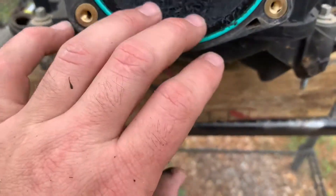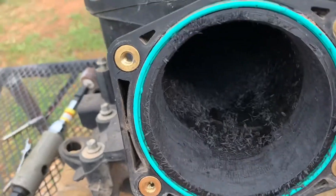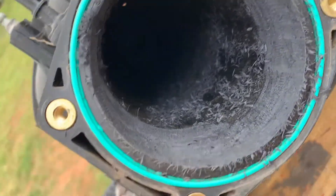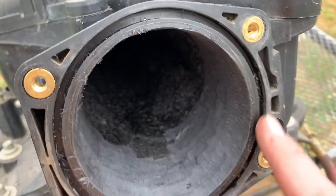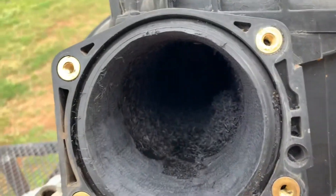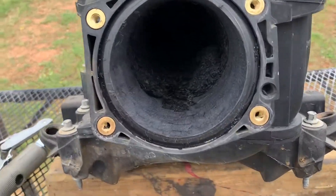All right, so we got to start getting close down here. I'll port it pretty good, get the mouth open, then I'll blend it all the way back and try to get these high spots out of it. I pulled the o-ring out - it's easy, just pops out with your fingers. As you can see right here there's a little bit of a lip, a little high spot. We got it pretty well blended on the mouth where it kind of tapers in nice. Got most of the high spots out. I swapped to this long bit - gonna get that lip out of there.